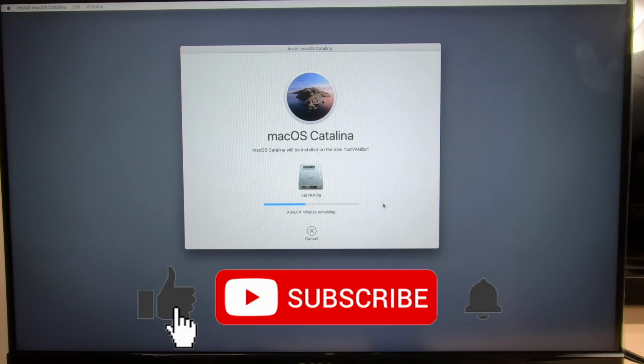Now, this motherboard, just so you guys know, does have the ability to use Intel graphics, which is built on the processor, of course, but this board supports it. But I could not get the accelerated graphics to work in Catalina on the UHD 630 Intel chipset. So if you want me to do this same build with Mojave, we can do it.